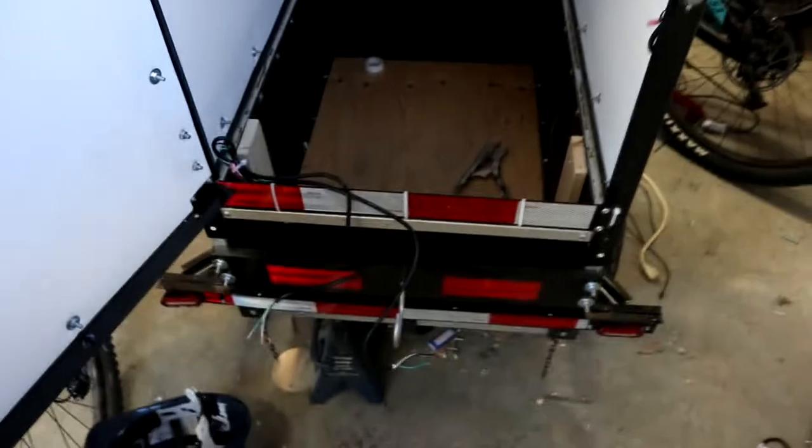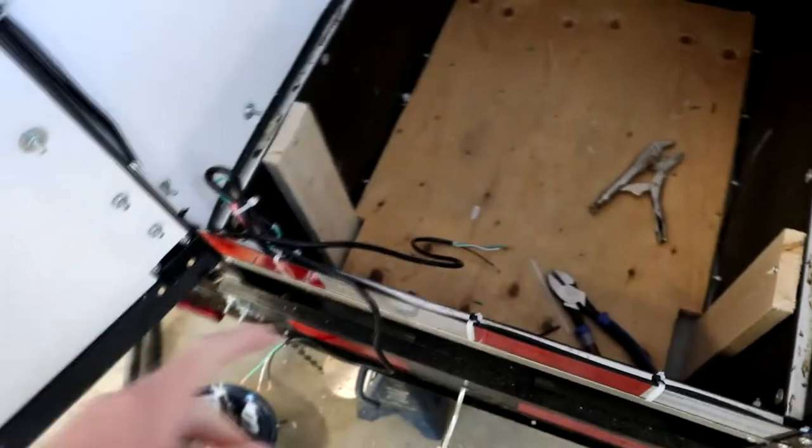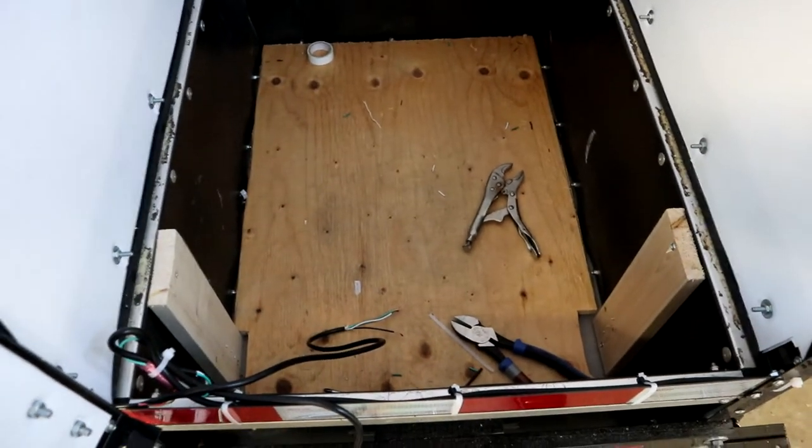I now have all the back lights spliced. The light bar is going to be coming next week, but I did leave the ends of these crimps open for the light bar to splice onto. For now I'll show you all of these lights. One of these cords will operate all of the lights except for the back two, and the other one will just operate the back two. The way you select the mode is by touching the ground wire, which is attached to the yellow sync wire on the actual lights, to positive or negative, and it will change the flash pattern.